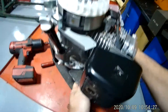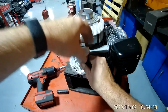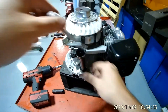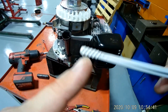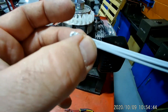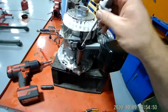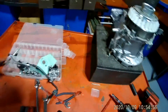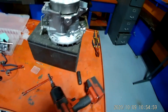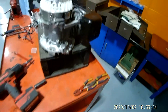Now let's go around to this side and spin this on the table. Right here it says 'oil' — this is where you fill your oil in at, this is your oil dipstick tube. Basically if it's on the crosshatch here, you're good. If you get above that and you've got too much oil in it, you're going to have to drain it back out, and it looks like you drain it right here — so that's nice. We're going to take this right here, it should just pop out. We've got the oil fill off and the throttle assembly off.